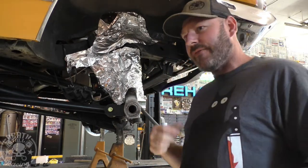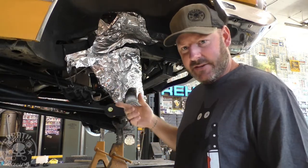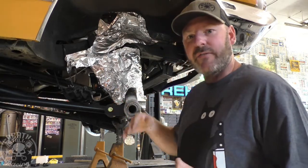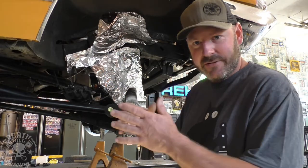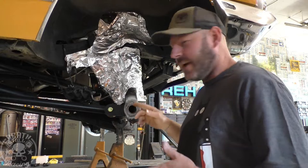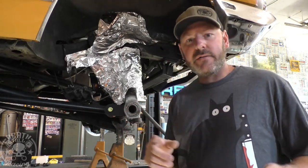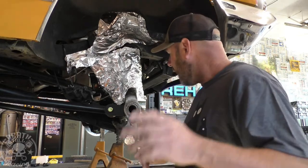I'm using .035. I'm just going to use mild steel. It is not a bad idea to do stainless if you wanted to, like a 312, kind of a higher number, 300 series, 309, 312, something like that would be good. But if you do that, remember you have to run argon gas, not the CO2 argon mix. So let's get going.